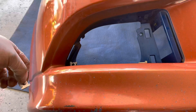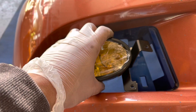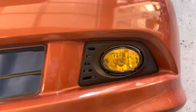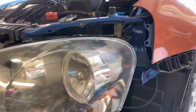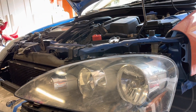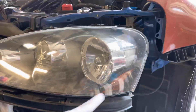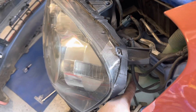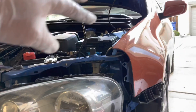Now for installation it should be easy. Instead of doing all this other stuff, what I'm gonna do is just cut this wire and connect it to the low beam — that's much easier so I don't have to drill another hole and put a switch. So if I turn on the headlight low beam, the fog lights are gonna be on too. Otherwise you can do all that stuff and drill a hole.